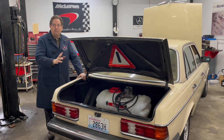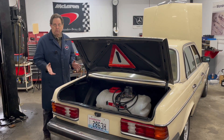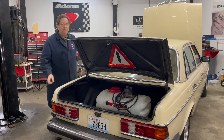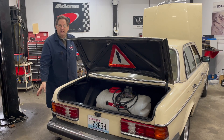The main reason I am using two tanks is because I want to be able to flush the system with diesel fuel after I've run it on vegetable oil. I do not plan to use this as a daily driver. If you're driving one of these every day as your daily commuter, you can run on one tank because you never let it sit long enough for the vegetable oil to congeal. Have any of you ever tried to clean up vegetable oil that you spilled on the ground, come back 30 days later and try to clean it? Just imagine if that's happening inside your injection pump and inside your injectors — you will get coking.